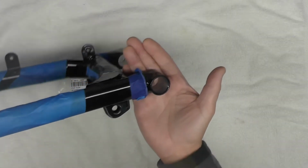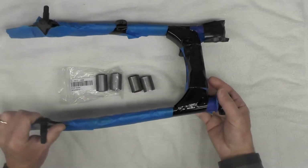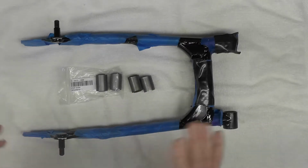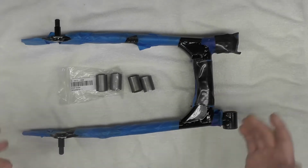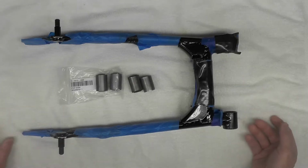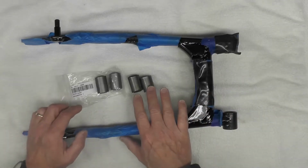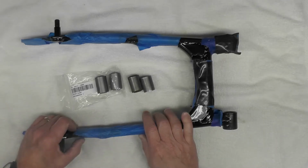The swing arm cleaned up of the powder coating. See right there. I want to talk a little bit about the technique I'm going to use to install the swing arm bushings. There's a couple of different ways you can do this. I'm going to use a 20-ton hydraulic shop press. Now, I realize not everyone has a shop press. You can use all thread with washers and nuts, which I actually demonstrated a couple of years ago when I restored the Yamaha YL1.